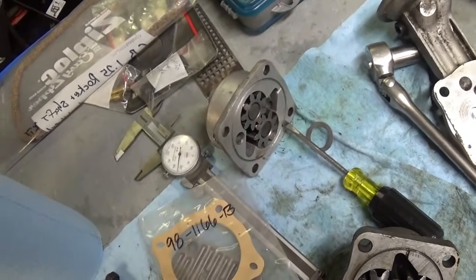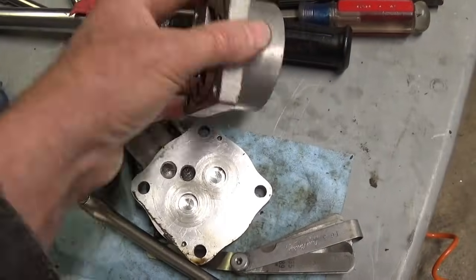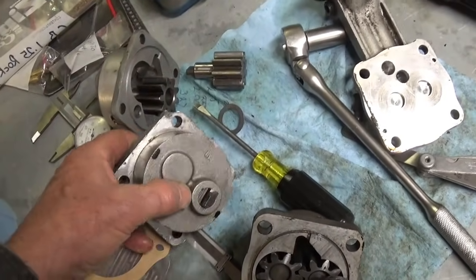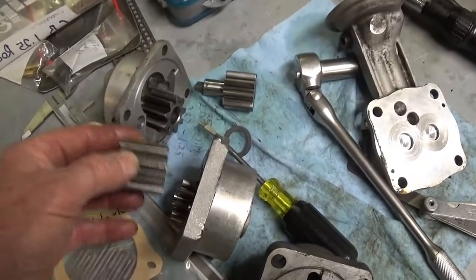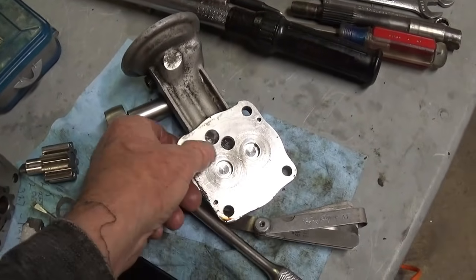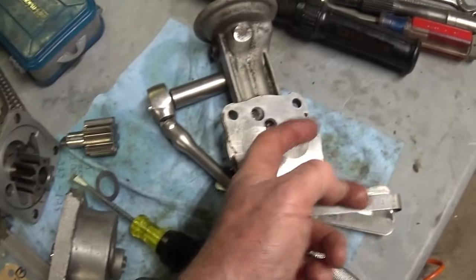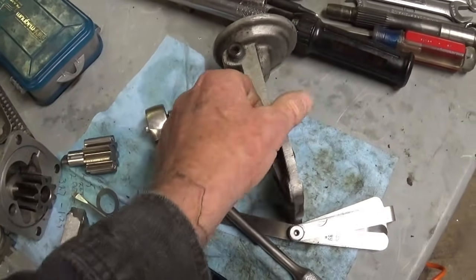See where the wear is - this is aluminum, both sides. Now here's something good to show you: that's a stock 26mm gear, and here's one for the big pump - look how much bigger that gear is. The reason they give you the big gear is to make more pressure for higher RPM. Instead of coming out the end and going up into the case, it goes down through the pump, through the filter, has to come back, then through this little hole just to get back to where the factory started from.